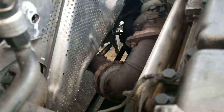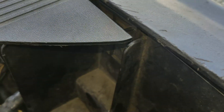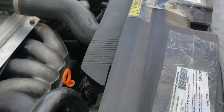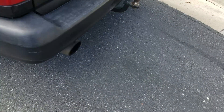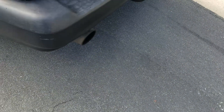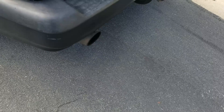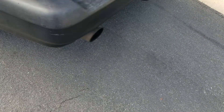I'm going to look for the heat shields and some hardware for this heat shield, a couple of screws in the front of this fan shroud, and I think we're done for the day. I don't see any smoke at idle, but if I'm just accelerating and then shift and that RPM is going up and drops, man, it puffs smoke good.